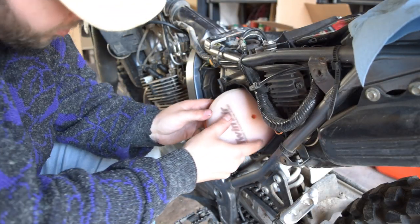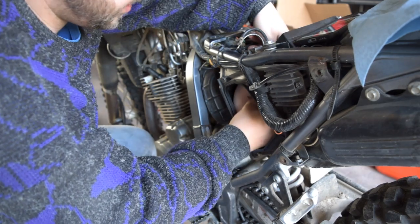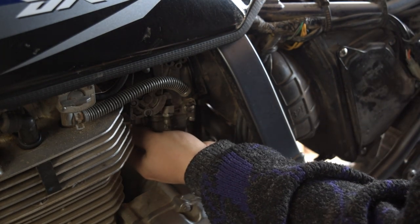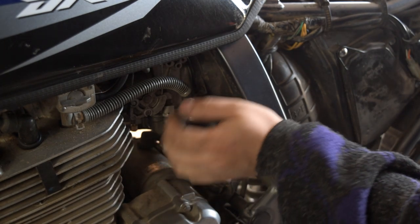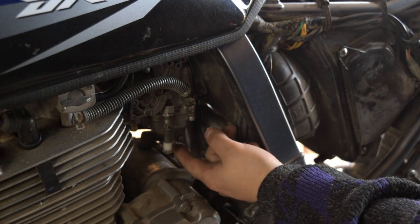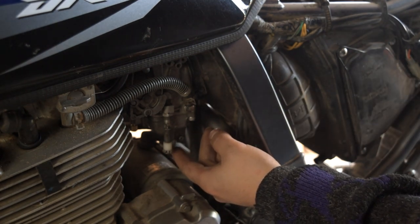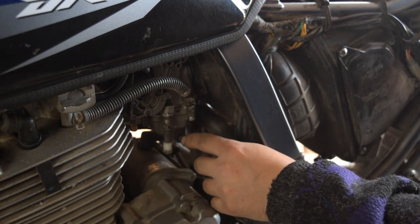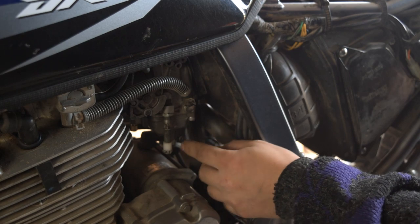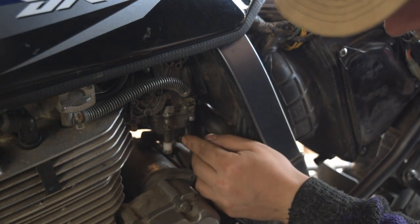On top of everything else, we also have a brand new Twin Air filter going in there - it's oiled, although not with filter oil right now because I don't have any on hand. Now changing out the jet and drilling out the air box would be considered macro adjustments. Then what you have is your fuel mix screw - we replaced it with an extended one a couple videos ago. We'll say we have a 155 jet in there - 155 units just for math's sake - and then we have whatever X number of units of air coming in from the air box. The 155 jet is a max capacity, but we might not have quite enough air to match up with a full 155 units. So the mix screw will allow us to tone it down, bottlenecking the amount of fuel that can come through that jet.